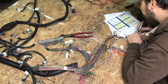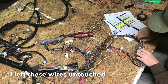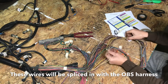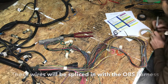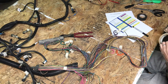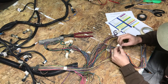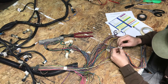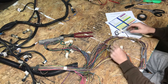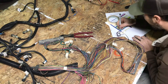Another park neutral safety wire. I don't know if I should remove it or just keep it — either way I got to do something with it, so I'm just going to go ahead and leave it be but I am going to identify and label it. That will be input P. I believe these wires get tied in with the OBS harness — I'm not 100% certain on that, but we'll figure that out when we get to that point. That's why I'm not just cutting them and discarding them — anything I'm not sure of I'm keeping around.